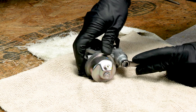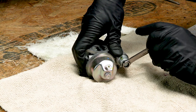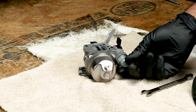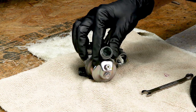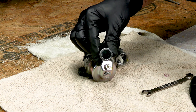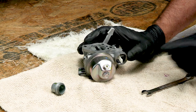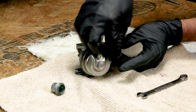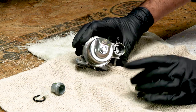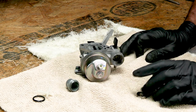Let's go ahead and take it off — it's got a fuel filter inside. Even if the bowl is empty, depending on how long you're going to store it, this is going to stay wet in here and rot this out. It looks pretty good now but there's actually a little bit of fuel in there. So I'm guilty of my own advice — I didn't follow it. Here's the little fuel filter, just go ahead and pull this out. It'll come out with the O-ring and we'll clean that. You can see how that would hold fuel and rot it out if you're going to store this for a year or two.